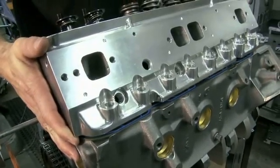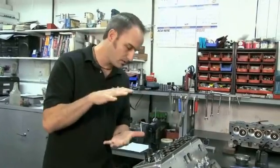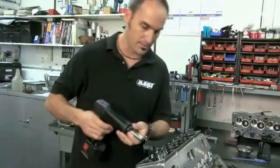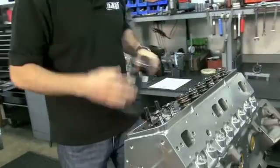We've got our gasket down. Lay the head on carefully, run your head bolts down, press that gasket. Now you've got the right stack-up and right clearances. I'm just going to run one down here for mock-up.